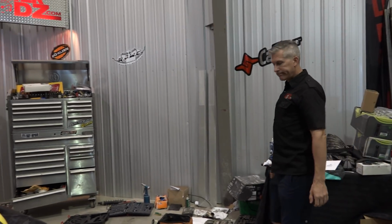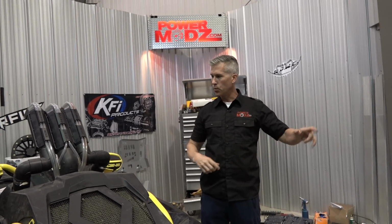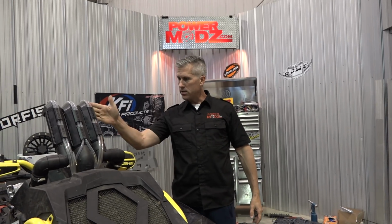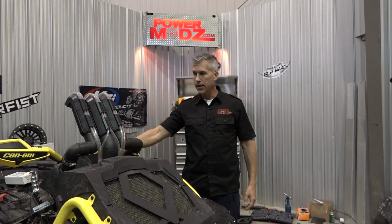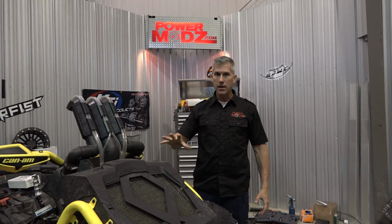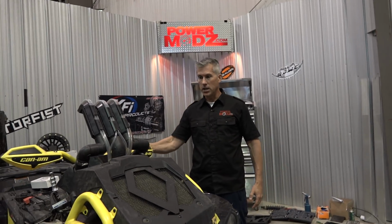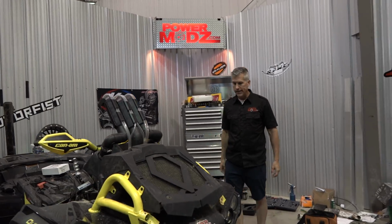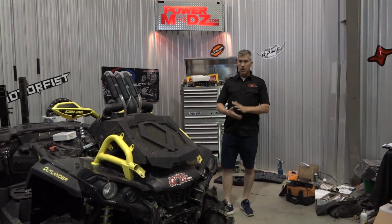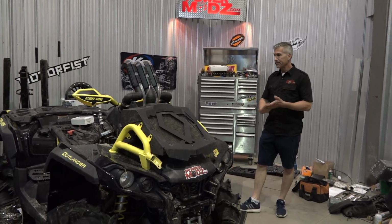Not so good. And the power steering, the other day when I was on the trail after a run, just started doing this. It was the weirdest looking thing. Almost ran me into another bike and then it did run me off the trail. So something in that power steering unit is not right, and other people have had the same issue. It just starts moving back and forth. You can let go of it and it just goes beep, beep, beep, beep, and that's not cool. There hasn't been a recall on it yet, but they are looking at the power steering unit.